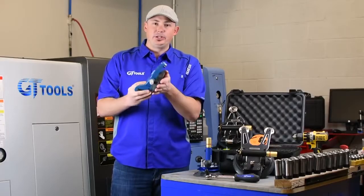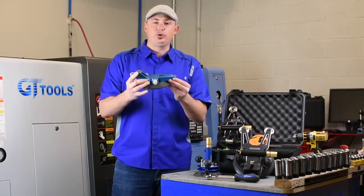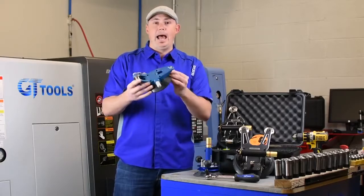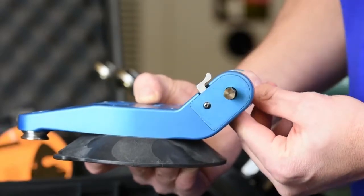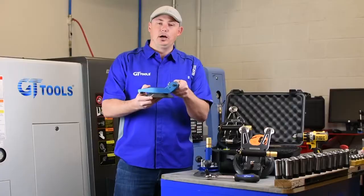The foundation of this tool is on a 6-inch curved cut. So this tool is a great product for windshields, quarter glass, or back glass. It features a locking back drive system, so all the progress you make when you're cutting isn't lost because of that locking back drive.